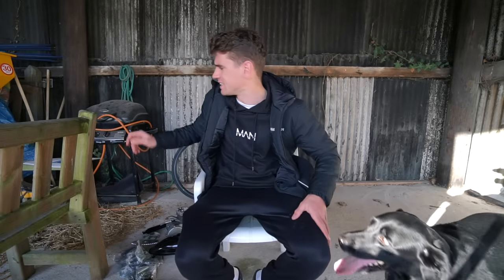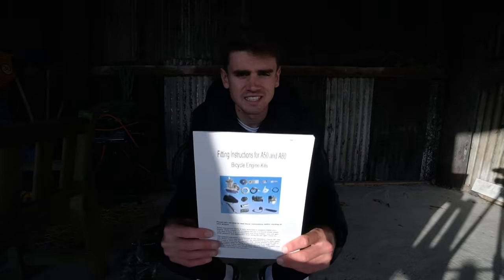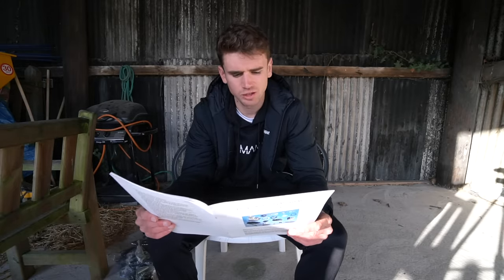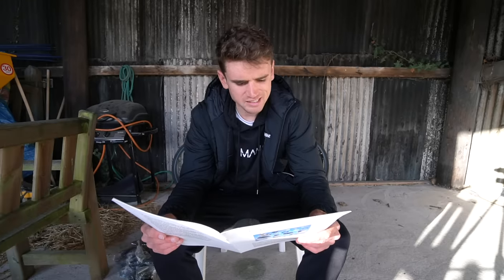Full disclosure here: I've never built a motorbike before. I'm a cyclist — I ride bikes, I'm not a mechanic. But right here, included with the engine, we've had the fitting instructions. Step one: there are two rear sprocket rubber packers. Cut one of them and only one — cut only between the drilled holes. Place the cut one inside of the spokes.